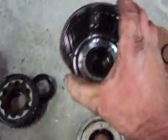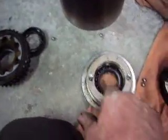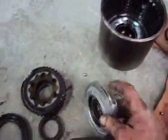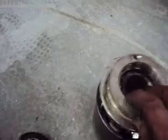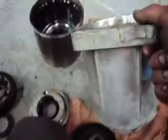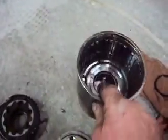When you get it, this drum is sealed. Whatever lubricant is sealed inside — here is the top cover — there was an oil seal in here that sealed it up, so the shaft assembly basically sticks through there and is sealed. Around the outside there is an O-ring, so when this drum assembly sits into the housing, it is completely sealed. The gear lube that is in the rear differential does not lubricate this assembly. In fact, when you bolt this assembly up to the rear differential, it's actually dry inside, because all your lubricant is contained within the clutch assembly itself.